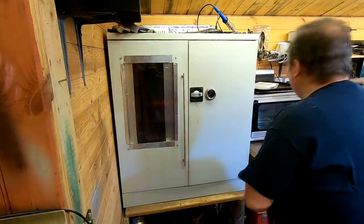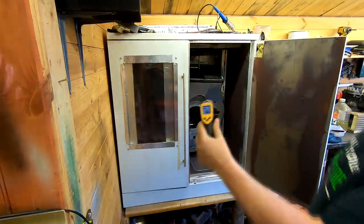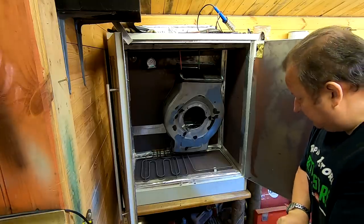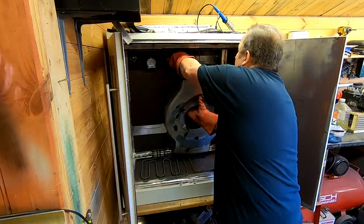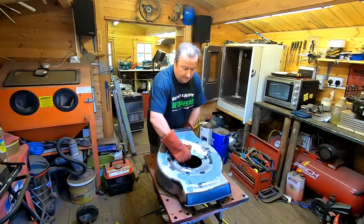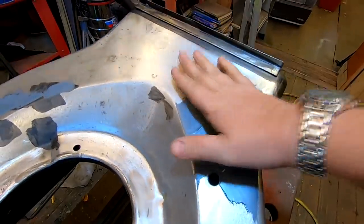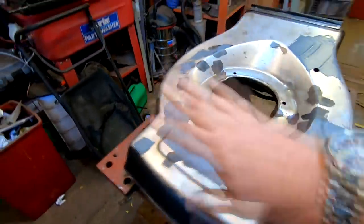This has been in the oven for about 20 minutes now. Let's see what temperature it's at — it's cooled down a lot. It's still 66 degrees centigrade so it's still pretty hot, but I'm going to get it out and let it cool in a cooler environment. It's been standing in there for probably 15 to 20 minutes. You can see how much easier it is to hang in there without the brackets — that was the whole reason we took them off. There we go — this thing is now ready to sand down. The great thing about this filler is it's rock hard in probably 20 minutes. I'm going to get my sander out, sand these little bits flat, and then we'll have a look at powder coating it.